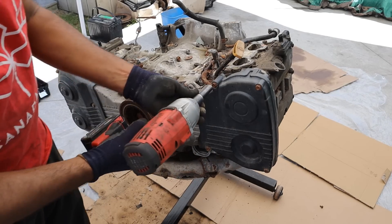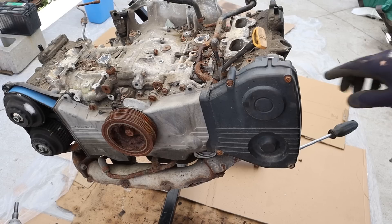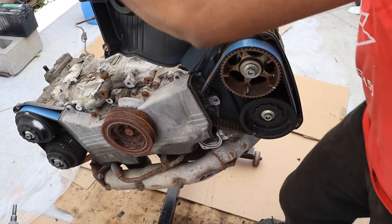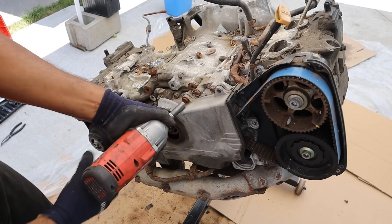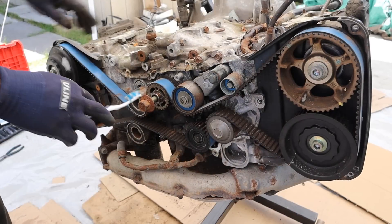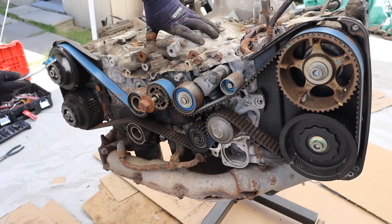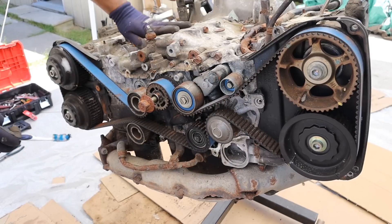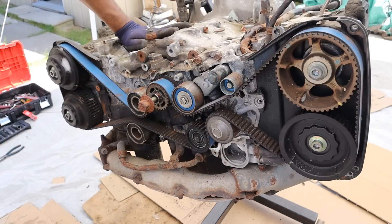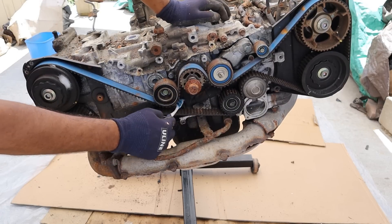Next let's remove the timing covers in the front of the engine. There's a blue timing belt in here! With the covers off, we can see the unique timing belt setup: you've got a crankshaft in the middle driving dual overhead cams on both sides. This engine does not have variable valve timing. There are a total of five idler pulleys, plus your water pump pulley. Just next to the water pump is your thermostat housing, and just behind this crank pulley is the oil pump integrated into the casing.